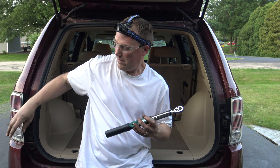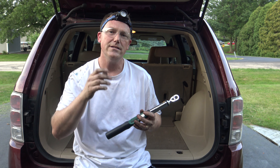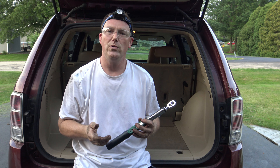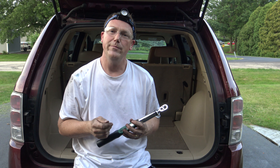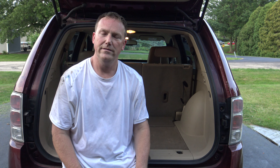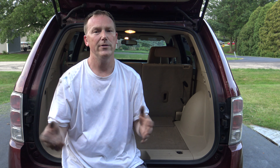When you're getting into the driver's side where the exhaust covers things a little bit, I have a headlight on — it just helps me see a little bit better. Out of all six bolts, I had one that was giving me a little bit of an issue at the end, so I just took the tap, chased the threads a little bit, and it went right in. Once you've got everything torqued down, congratulate yourself on a job well done. You did it all yourself, didn't have to take it to a mechanic, and saved yourself some time and money. It should have taken you less than an hour from the time you unboxed your hitch to the time you were cleaning up.